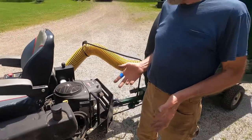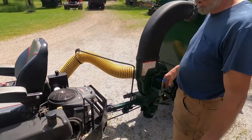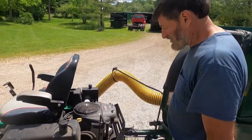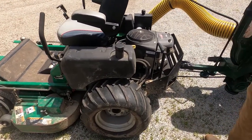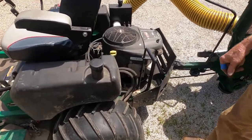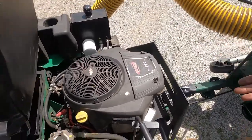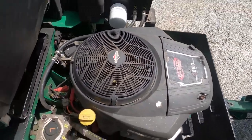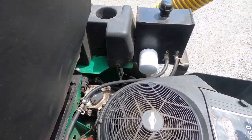Another thing I was concerned about was the weight factor on the tongue on this back haul unit. Because when you get a little wet grass in here, you get a lot of weight — you can pull wheelies with this thing real easy. So when all that was changed around, now you're not going to break it. And I upgraded the engine — I went from an 18 horse it had originally to a 26 horse. Now I have enough power to run the back haul unit while mowing. Before, it was just laboring the engine too much. But now everything seems to be just right.